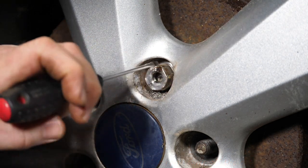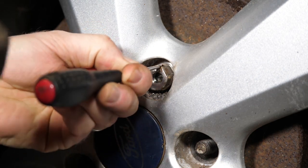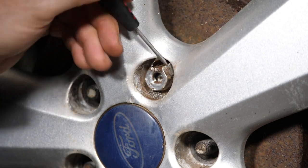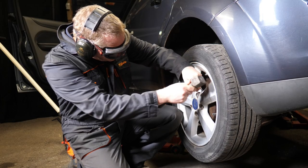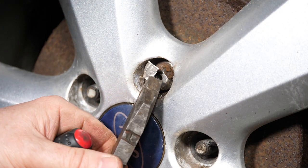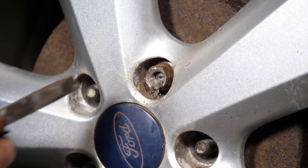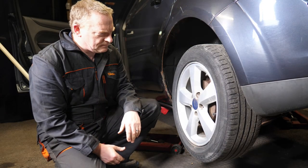This is turning into a bit of a mess. Having to start using chisels and things risks damaging the alloy wheel. We're gradually peeling the chrome cover off but it's a little bit of a game. I think 24mm is probably the wrong size — the next size down is 22mm which might be too tight. When I was looking online they mentioned a one inch or 25mm hole saw, so I'm not quite sure what I've done wrong.